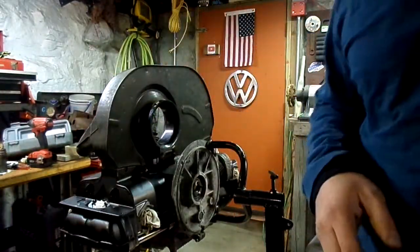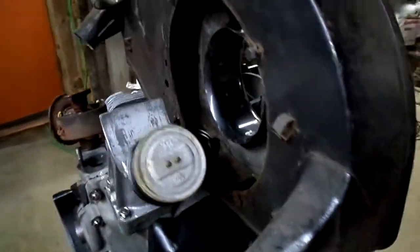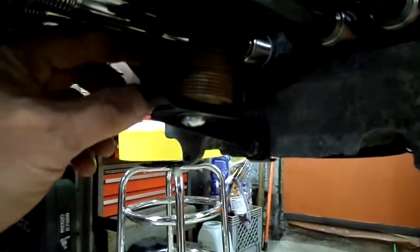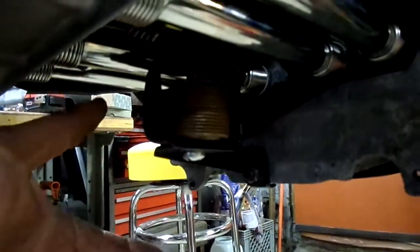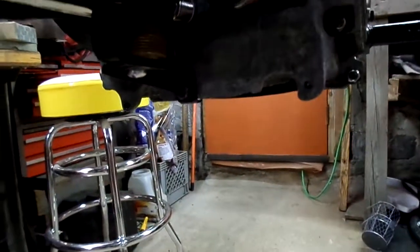Check this out — this is pretty cool. The throttle ring is up against the fan shroud; none of this is in place yet. I had to cut this notch here so this linkage could all get connected. Down underneath that's the thermostat, and when this heats up — because it's air-cooled — it expands like an accordion, pushes the linkage, and opens the throttle ring up to allow more air. Before the camera dies, let's heat this up.